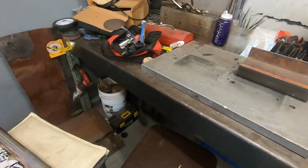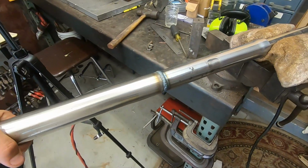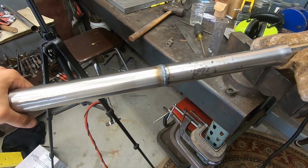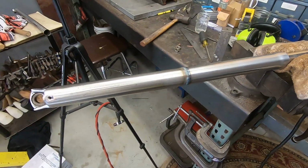So, top pass, if you're trying to metal finish stuff other than sheet metal, regular steel stuff, sometimes you might have to go a little colder, because when you're burning the stuff in there, you might undercut it sometimes. So, let's do that.